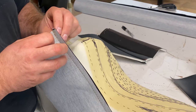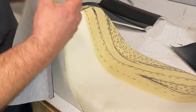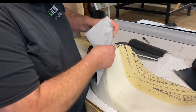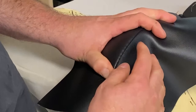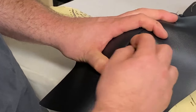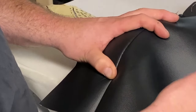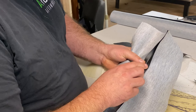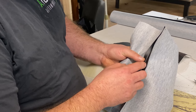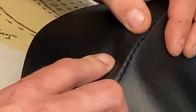When you do a French seam, you'll actually spread this apart — a French seam gets a top stitch here and here. So now you could top stitch on both sides. On a custom seat it won't matter much, but it's really only going to affect you if you're riding a lot. When doing that, you'll have your stitch mark and a little bit of material, which we trim off on motorcycle seats so it rides right up against the stitch. Otherwise, when you pull a tight seat cover, there's a little bump or ridge where the material ends, and you don't want that.